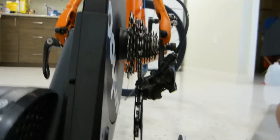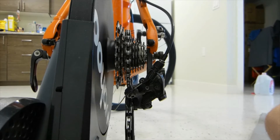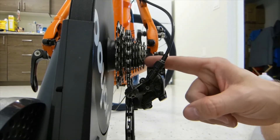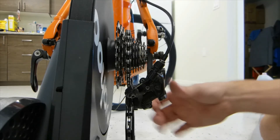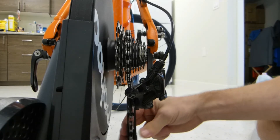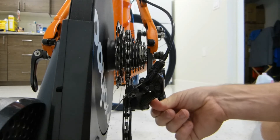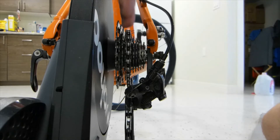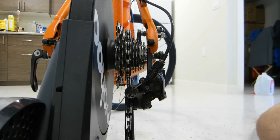So that's the vertical alignment of the rear derailleur, which is absolutely critical. Otherwise the bike is going to continue making these noises, where the tops of the teeth will hit the edge of the side plate because of this slight misalignment here. Normally it flexes in like so, and it should move parallel with the sprockets above. But it has this little bit of extra bend to it that shouldn't be there. I hope that makes sense.